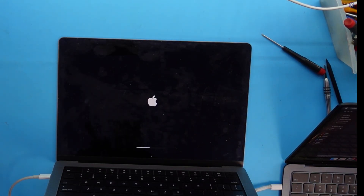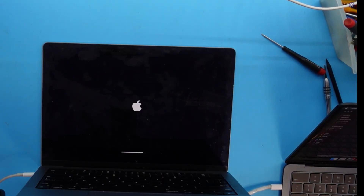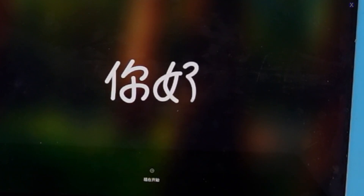The prompt tells us what to do — you go to the website and it gives you instructions. You have to connect another MacBook to it and restore the whole firmware back to the device. This method does wipe all the data, but it ensures it's going to power on and work properly. It told me on the other screen to disconnect the Mac, so it looks like we're good. And it's like a brand new computer. So we were able to fix the A2442 2021 M1 Pro MacBook Pro with the liquid damage, and we also had to do work with the firmware to restore it back to a working MacBook.